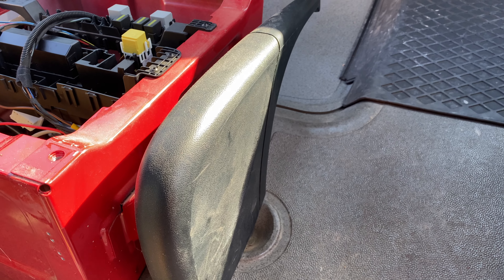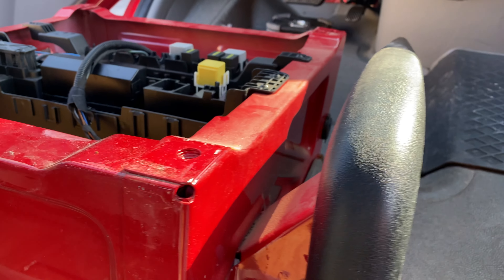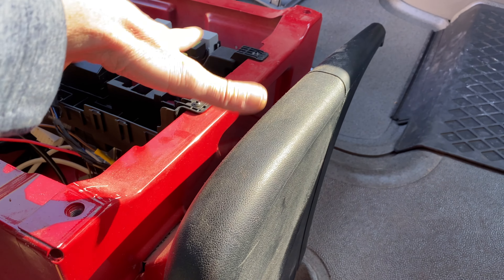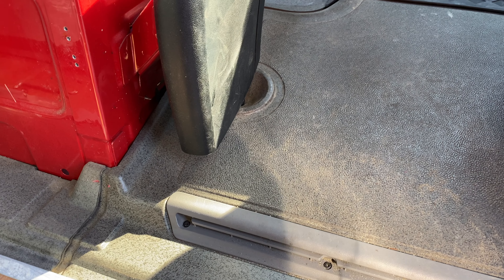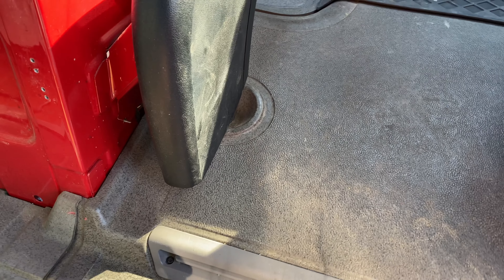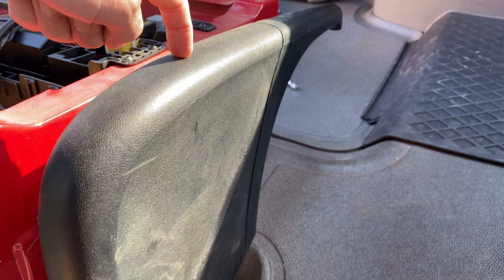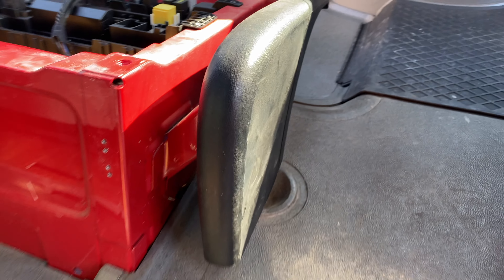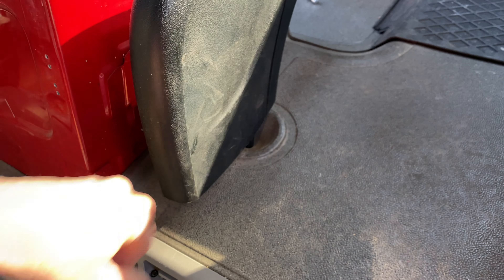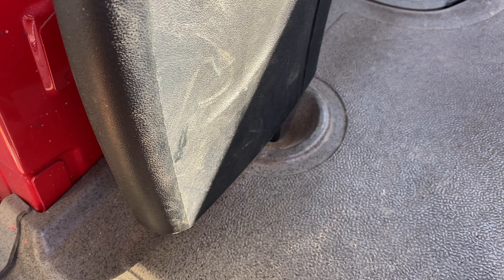On the driver's side we will need to install this parking brake lowering bracket, because the parking brake is higher than the pedestal. The pedestal when it swivels would contact it, and there are a lot of different options in these vans that make the floor height different. This particular van has the rear heat duct which raises the floor higher. We'll have to remove this plastic case — there are a couple bolts that attach it to the bracket on the pedestal — then add the lowering bracket, and trim the plastic because lowering it will make it contact the floor.